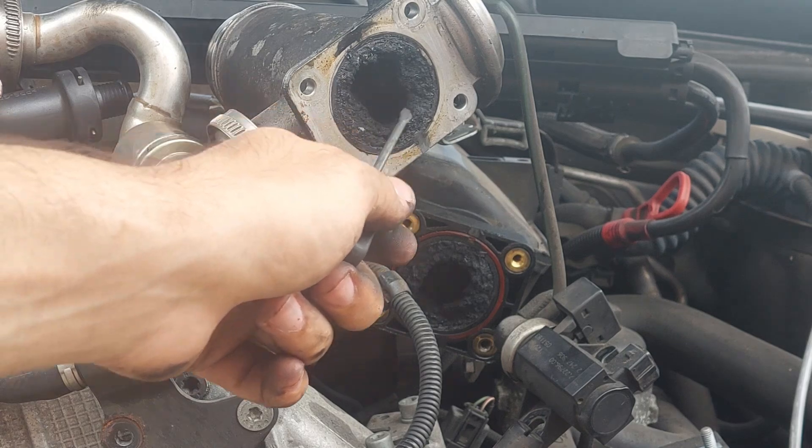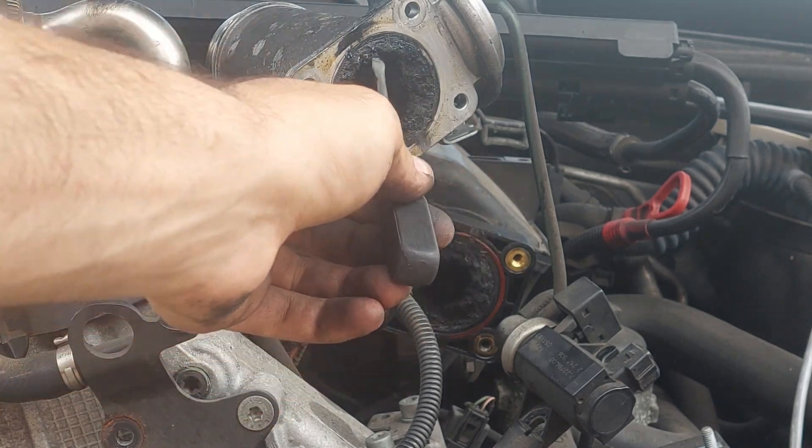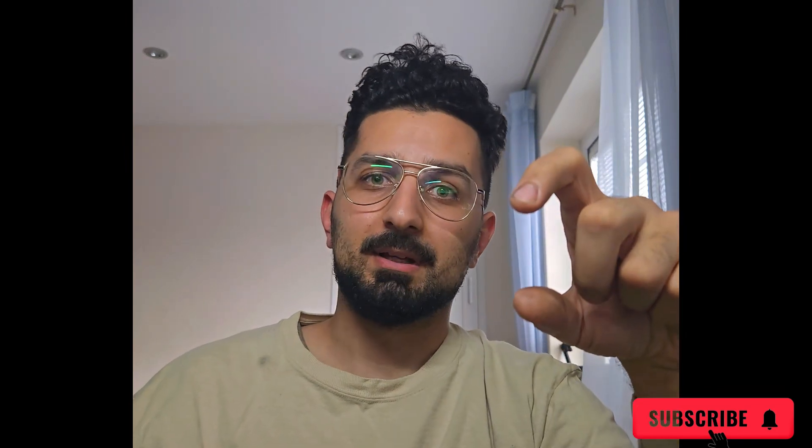I've got the whole front end open and I thought, let me delete it. The whole point of the EGR valve is it makes your engine a bit cleaner by taking the fumes coming out of your engine and sending them right back in. What happens over time is it starts blocking the intake manifold, reduces performance, and causes all kinds of issues — and if it's not done in time it will cause you to break down. So in this video I'll be removing it and filling in the gaps with this kit. You can buy it from eBay for about 15 pounds. By removing the EGR valve, hopefully my engine lasts longer, I should have more power, and I won't get this build-up happening again.